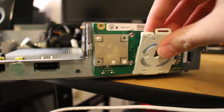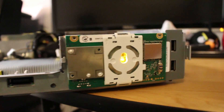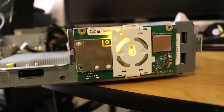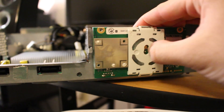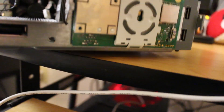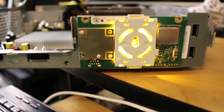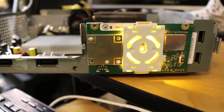Congratulations, you're now done. All you need to do is hook up this RF board back to your system, turn the console on, and if it boots up with all the lights, you should be good to go. I like to test these on a Xenon because it allows me to see that everything works. As you can see, what you just saw right there is what should be showing when the lights are green, but if you unplug the audio video cable in the back, it will show you what will happen if the lights turn red - and they all work. Now all you need to do is sit back and admire your work and dazzle your friends whenever they come over. Anyways, this is Mr. Mario signing off - thank you for watching everyone and I hope I helped you all out.